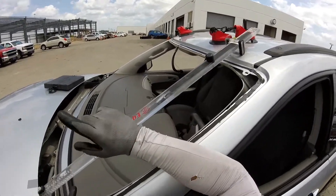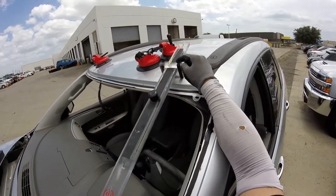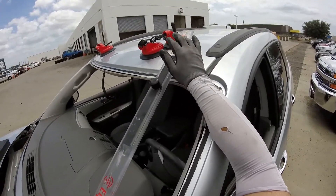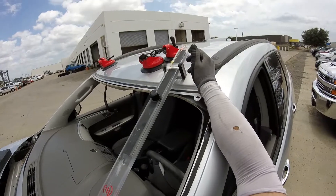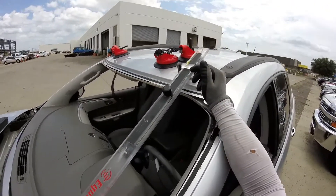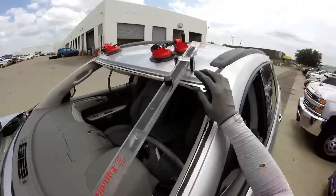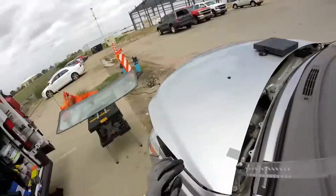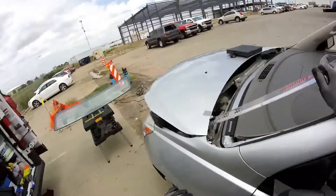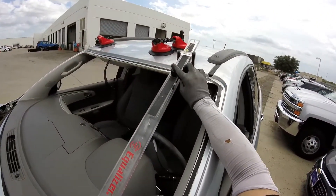This is gonna be the first time you see this. The security thing I did is I'm gonna secure this part here because I don't want this part of the stick to drop inside. This is an old one — I've had it for a long time. I never tried using it this way because I don't like putting the glue on the body. I prefer applying on the glass, the same like the factory does. You see videos from the factory — they start the bead on the glass. That's why I'm using this adapter.